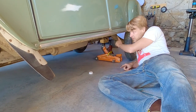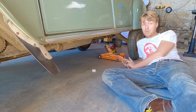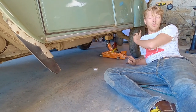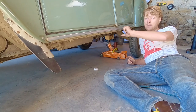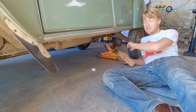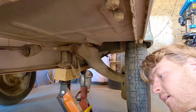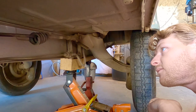In a previous video I showed you how to adjust your 2CV suspension. In that video I didn't use a jack stand and a bunch of people freaked out — I didn't use one because I wasn't under the car nor was I removing a wheel, I was just adjusting what was already there. However, I am going to be removing this rod end, so I will be using a jack stand because the car won't be supported by its own suspension. Let's remove that pin — I have some kitchen roll on standby because this is going to get gooey. These never come out as you think they will.